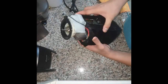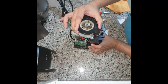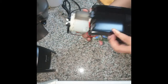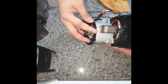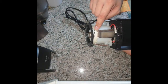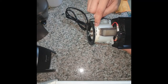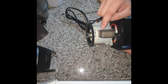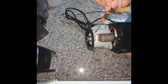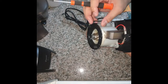I'm going to turn it clockwise and while I do that I look underneath this black panel. You can see this screw — this is actually the calibrating part right here. This is where you calibrate the grinder. When you first bought it, this screw will be placed in the first position. I placed it further in because I grind espresso and wanted to grind a little bit finer.